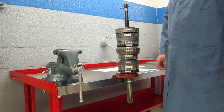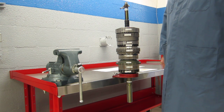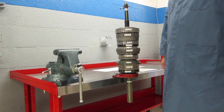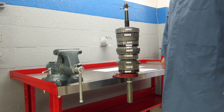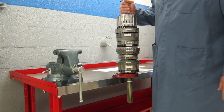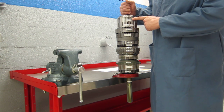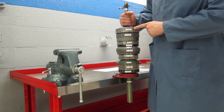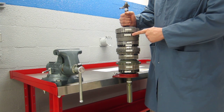One or more of those will be applied in the different gears as we move forward. We also have four clutch packs that are going to be connected to rotating parts of the planetary gear set to make them rotate. Two of them are underneath this housing — the C1 clutch and the C4 clutch — and then two of them are splined to the outside of these two housings: the C2 clutch and the C3 clutch.